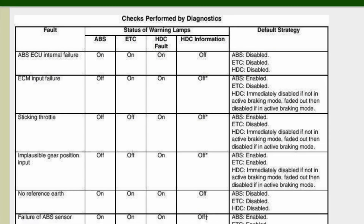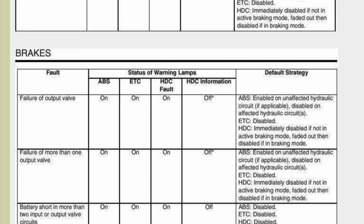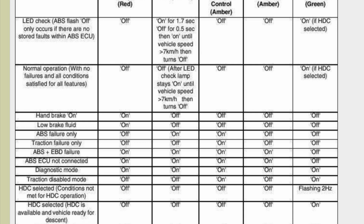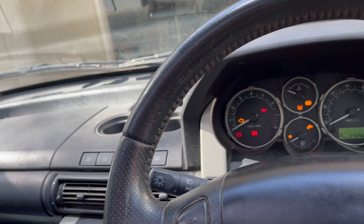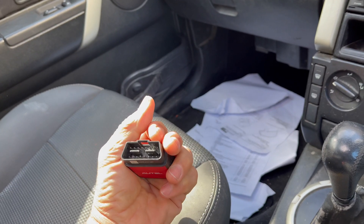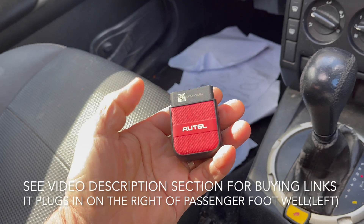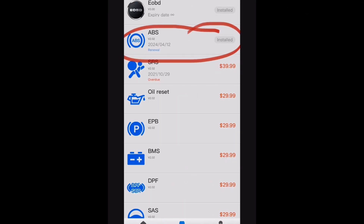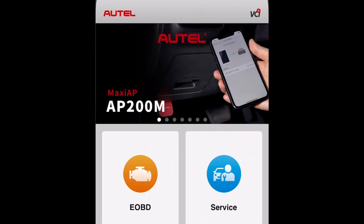There are a few different faults that can lead to these warning lights, as shown in this table of faults. Usually it's the ABS sensor. Some people say you can go around and measure the resistance of the sensors - there are a few different types used - but when I tried that it was inconclusive and didn't match up with quoted resistance values, even though I could later see via scanner that the sensors were actually working. By far the easiest time-saving method is to get a scanner. This is the Autel AP200C that I've reviewed on my channel, and it has software add-ons that can interrogate the ABS system. My option expired so I had to spend another $39 to get another year's worth of ABS scanning - well worth it.